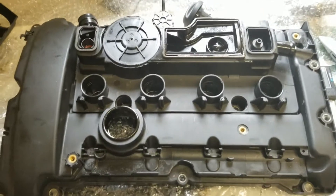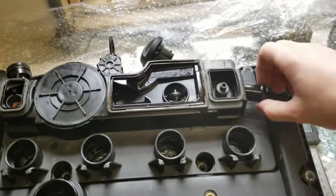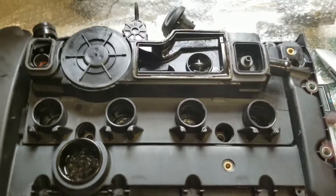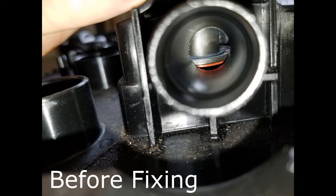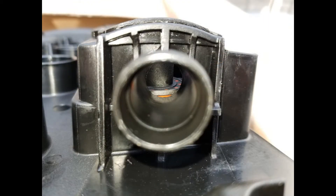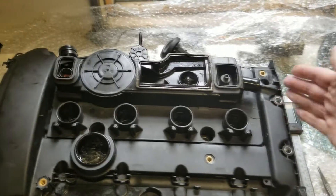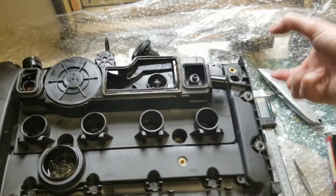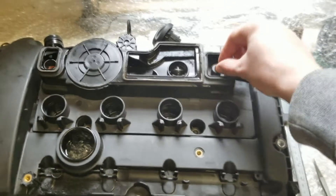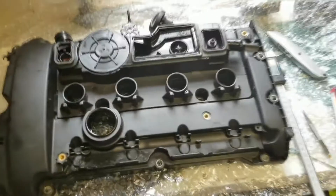That's the solution for these non-genuine valve covers. If you've got a similar problem — even if you're not aware of having a problem — I would check it by pulling that tube off here while the engine's idling and putting your hand on it. If you feel air pulling in there, you've got a problem because it's unmetered air. At least it is on the UK models. On American N14 models, I've seen pictures with a mass airflow sensor in the tube directly after the air box, so maybe it wouldn't be unmetered air there, even though it's still not meant to go in. But on UK ones, this draws air straight from after the air box, so it's unmetered and the engine doesn't know how much air is going in.